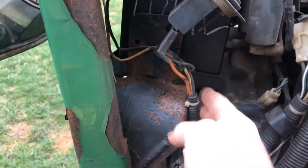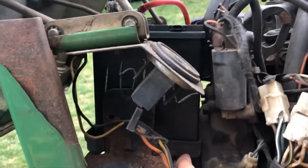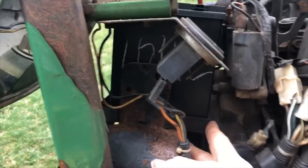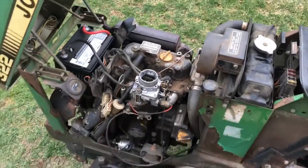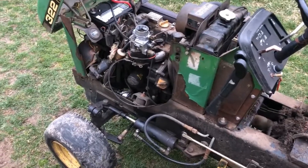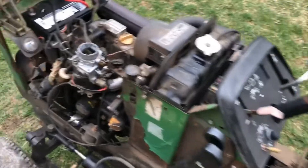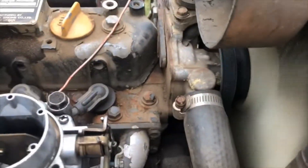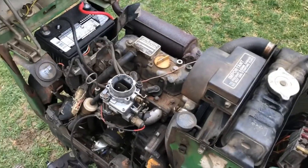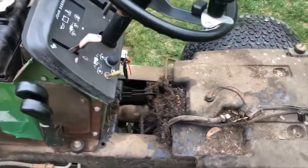I also need to look into the battery tray — I think there's a kit on eBay, but as you can see it's sagging back toward the engine. Otherwise, it is honestly a strong runner. It doesn't burn any oil and the oil stays clean for a while — internally this thing is pretty tight. The water pump doesn't seem to leak, although there is some residue. I'm almost tempted to do the water pump when I pull the motor to do the input seal, so we'll have to see on that.